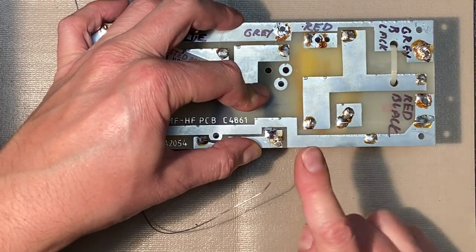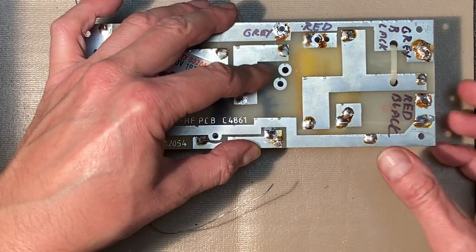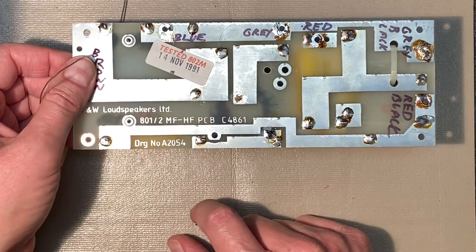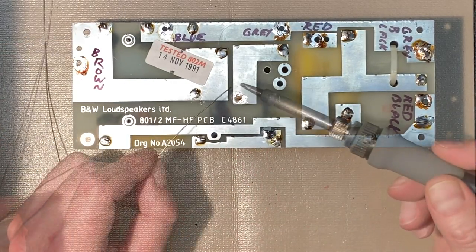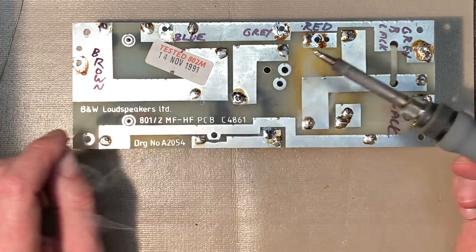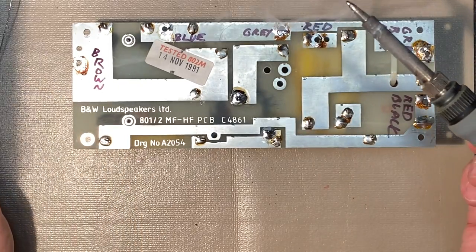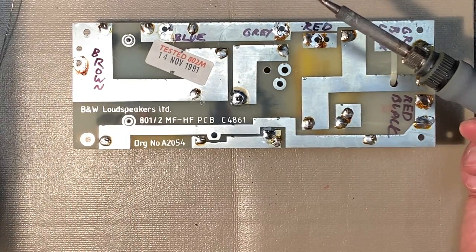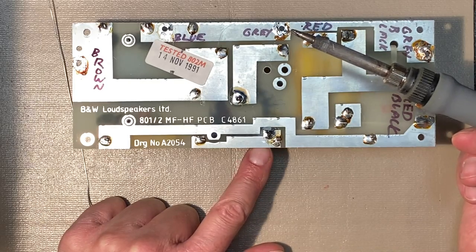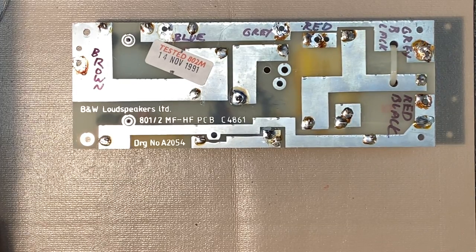Okay, I was just pushing down on this board while I solder to push the board and the coil as close together as possible and have the solder hold it there. Won't be as necessary on this side. That side is just about where it needs to be even without me pushing it. Using plenty of solder. Don't need to worry about overheating the coil. It's just a big bunch of heavy-duty, thick copper, so don't need to worry about overheating it. I'm just going to use as much solder on there as I can, sort of to have the best weld